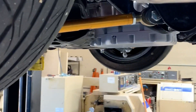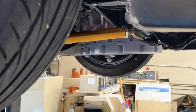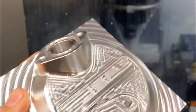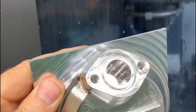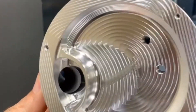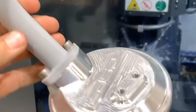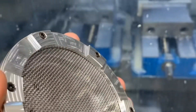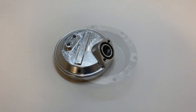Once we're happy with the design, it's time to go back into CAD and program the CNC machines. Here we're machining the oil pickup housing — a very critical part of this oil pan because it needs to be low profile but also capable of resisting oil aeration and starvation. Next we machine the retaining flange that holds the steel mesh screen to the bottom of the pickup housing. Here's a look at the final housing all put together.